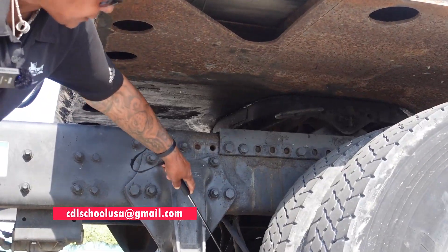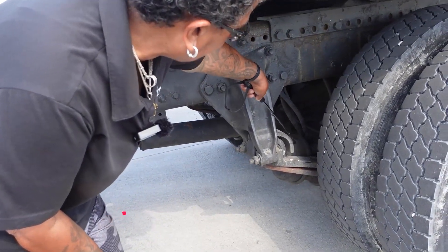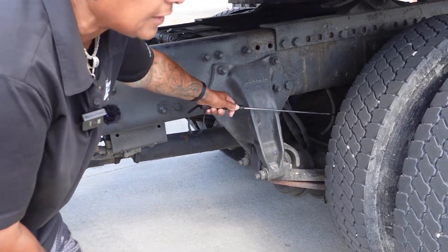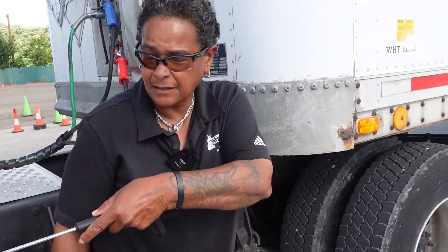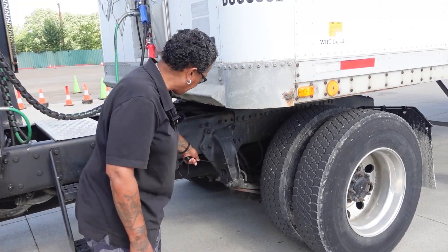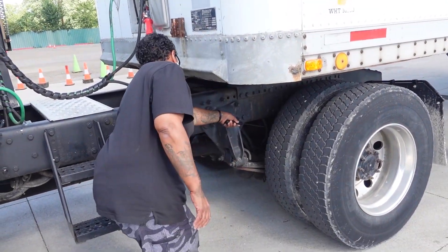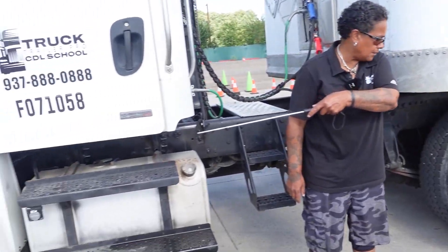I will drop down to my brake chamber — I have six brake parts: brake hose, brake chamber, push rod, slack adjuster, and inside this wheel: drum and lining. I would check my brake parts the same way as I did my steer axle. Suspension has four parts: spring mount, spring leaves, U-bolt and shock. I would check my suspension the same as I did my steer axle.